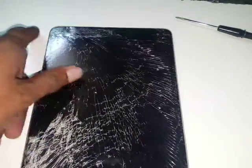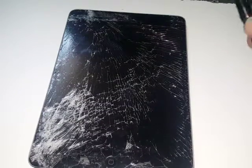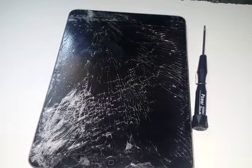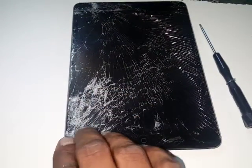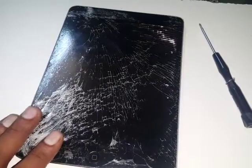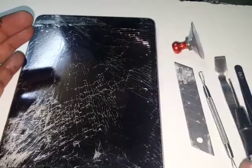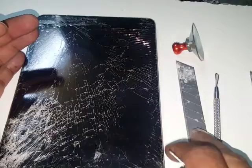Once it is off you can start removing the touch. For that you need a star screwdriver. The screen is shattered all around — although it's shattered proof, you can see stress tears in a couple of places. You'll also need a heat gun.